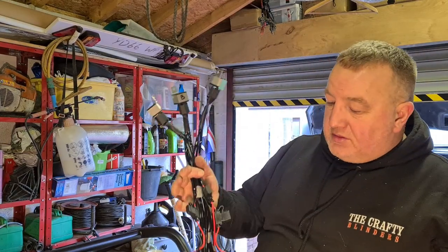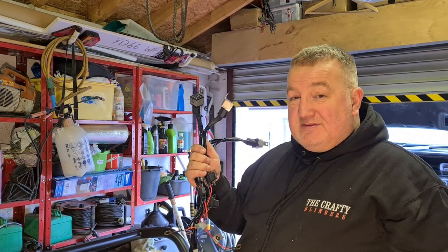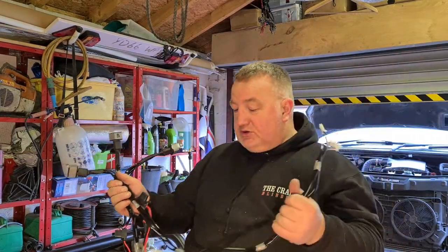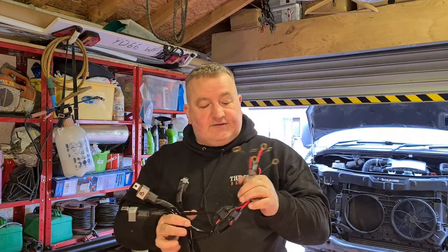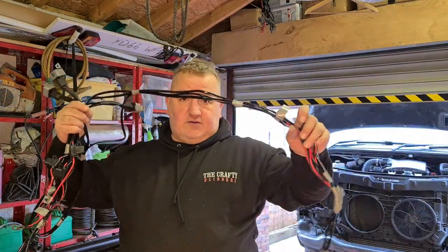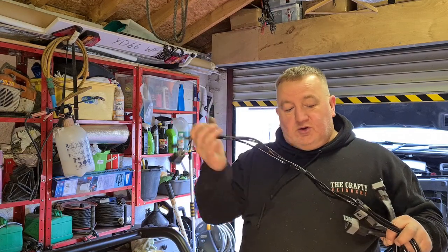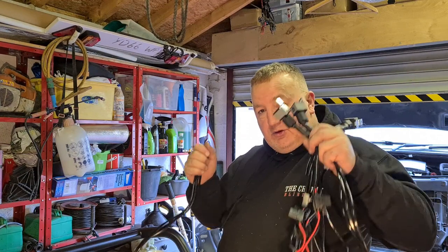I bought three looms off the internet — they're about ten quid. I like to buy the parts and cable but it works out cheaper buying one of these, as long as you're not going to put a big heavy load on them. What we've got here is this leg goes to the switch inside the cab, this is your power side all individually fused, and this leg here goes into the engine bay. I've lashed all three together and created a loom. When threading this behind the dashboard away from the switches, it'll all come as one, tie back as one, and make a tidy job.